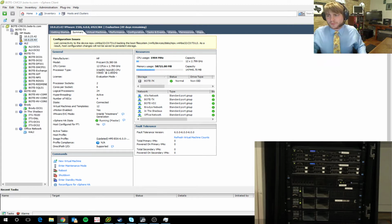So that's what I'm going to be doing for FreeNAS, and then I'm going to be using iSCSI with a quad NIC adapter, creating 4 different NICs that'll be used for iSCSI to all my different hosts, and I'll have 5 different hosts. Those will be the 5 HPs. So what I'm thinking is I'll be having my UPS unit at the bottom, the APC, I believe that's a 1500.